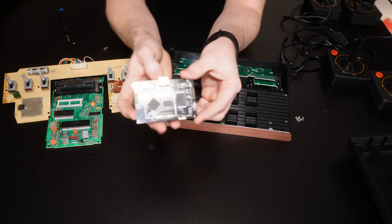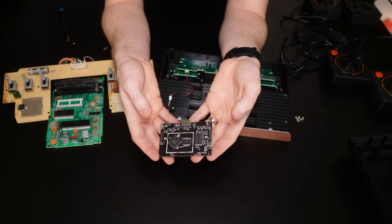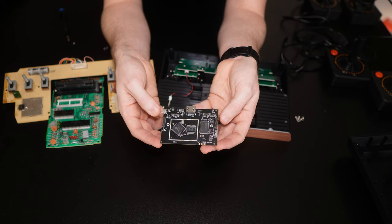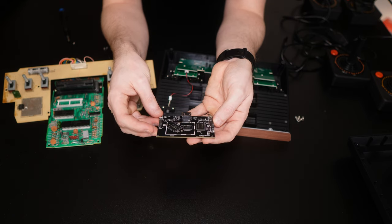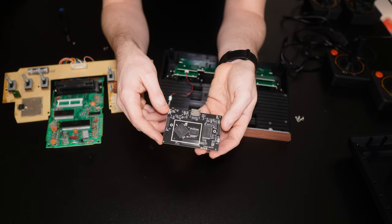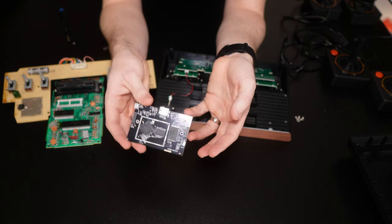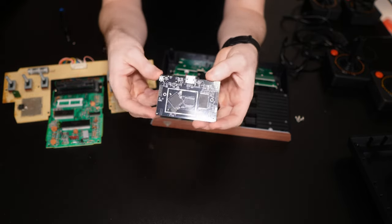This is very interesting — let me show this to the camera. So this has a recovery button labelled 'recovery', and it has a micro USB connector on there which obviously isn't usually accessible. I guess that's what they use to program these boards in the factory. And we've got pin headers here, which I guess is for a JTAG-type interface for programming. So we've got the SOC there, which is your CPU, GPU and everything else, all quite neatly contained on this little board that just plugs into the switchboard. There's definitely some potential there for flashing this — for people to hack it and get it running Doom, and for future firmware updates. That's the brains inside the 2600 Plus.